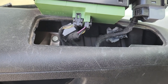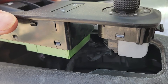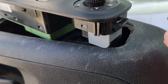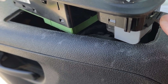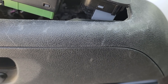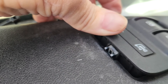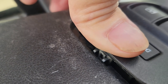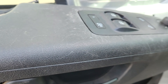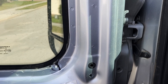I've got my three connectors here clicked in — I heard a good click. I did notice that this front element here for the control panel has a tab or finger that has to go into the door first, so simply drop that in first, and then click in from the back. There we go — so that is back in. Next I just need to put in the four screws to reattach the mirror and put the trim back in, and it will be done.